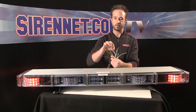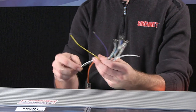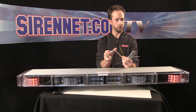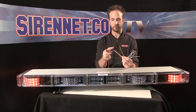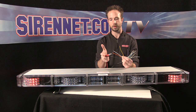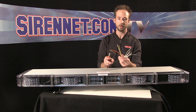What's nice with the cruise lights is that the intensity is adjustable. If you take the white with violet trace trigger wire, when the cruise light function is on, momentarily tap it to 12 volts and you can see the intensity changes. It programs itself — that's why there's the quick flicker and reset — and it drops back down to dim. It has four adjustment levels for its cruise intensity. Apply power to that wire, it lights up; take away the power and the function deactivates.